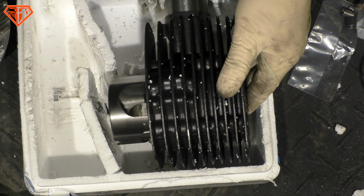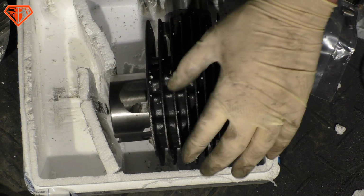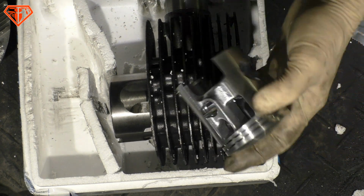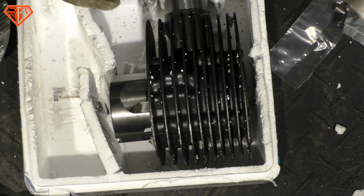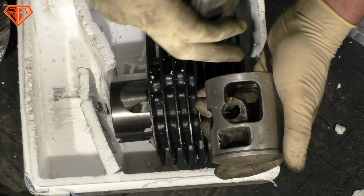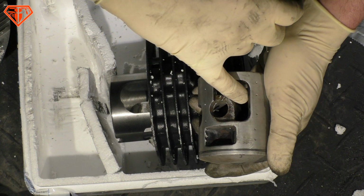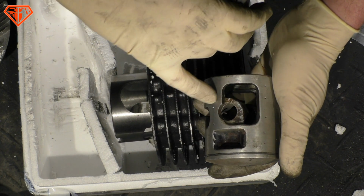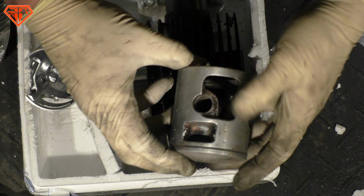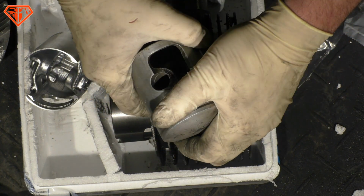The recommendation was to cut open the cylinder bolt channels. Do we still need that with this mk2 POLINI? I don't think so. Why don't I think so? The issue was that this piston was just not state of the art. You know, the piston skirt here is connected, here it's not connected, and so it always cracks somewhere here and here. I'll put some pictures in the video. This means that this whole piston was squeezed and angled and whatever.